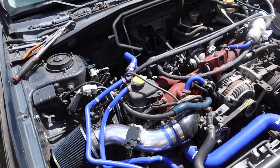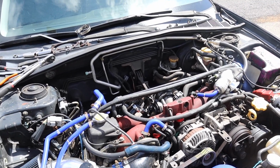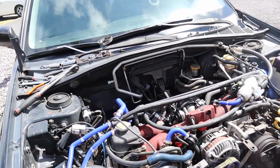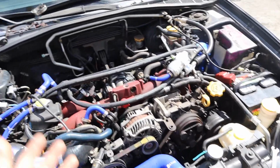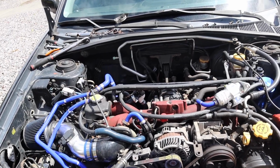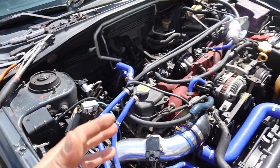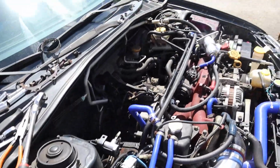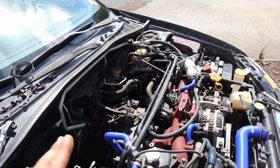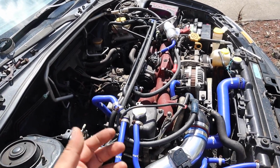I know that the car will still be missing because cylinder 4 is misfiring, and I know for a fact that the ringland on this engine, which is super common and also the weakest point of this engine, is pretty much gone. I just really want to get this car at least running to where it's maybe drivable. I just want to drive this car and see how everything goes. Going down through the sources, every little thing probably will help down the road and then lead us to where we need to do the engine. But for sure, I already have one lined up. I just want to take care of the small things first, see how that goes, and if it turns out that we need to change the engine, we will definitely change the engine.